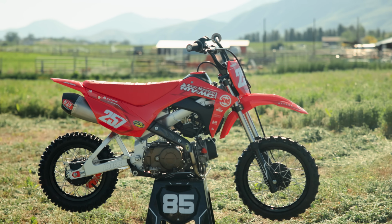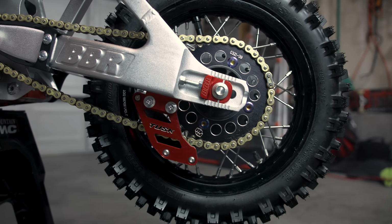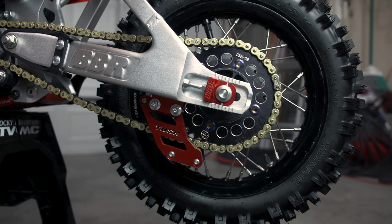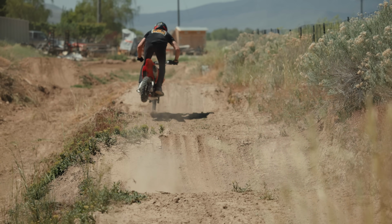It also gives you modern axle adjustment, so with the blocks and just a standard style chain adjustment. And so you can accurately and quickly dial in your chain slack. I really like that about it because the stock setup is a little janky. Your bolts are back there vulnerable behind the swing arm. So that's a cool upgrade for me.